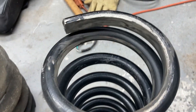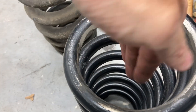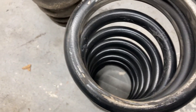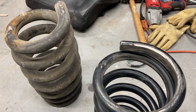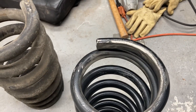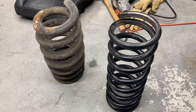I was able to grind the inside of this spring using a basic angle grinder, rolling it around inside to carve out and hit the high spots. It actually matches up really nicely - it's fairly round. It works pretty well and came out a little cleaner than I expected. I was able to put the micrometer to it and it all fits, so that should seat on nicely. Just got to make sure I don't cut the wrong end off - it took probably an hour of grinding to get it there.